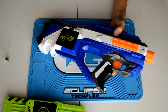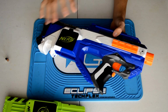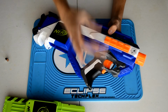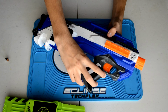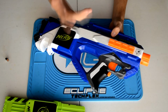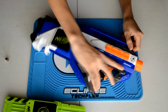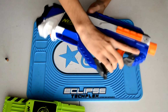this on a Strife. If you want to see how to do it, go check out my video. The wiring is backwards in this, so you might have to mess around with that a little bit. But it now decelerates a lot faster. Instead of letting it continuously rev out, it slows down really fast instead of taking something like 30 seconds to finally completely decelerate. And I really like that because it makes it a lot quieter. It's not running all the time, and it's really cool.